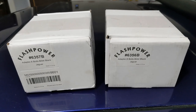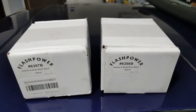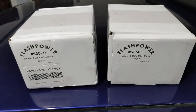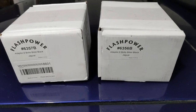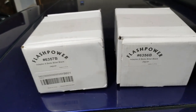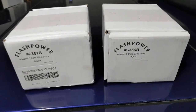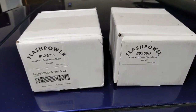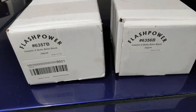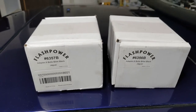Don't think you can get one for the other — not only the size of the adapter is different, but also the spline. The shaft for the steering wheel is completely different, meaning it's larger on the Series 1 than it is on the Series 2 or 3. These apparently will also work with the XJS. I don't have an XJS, only a Series 1 and a Series 3 XJ6.